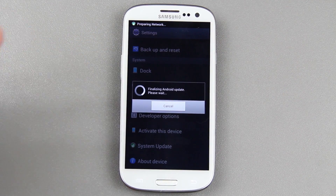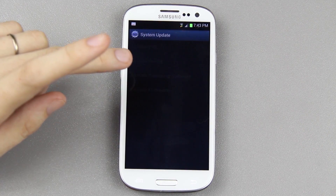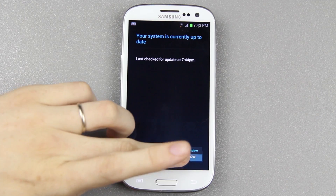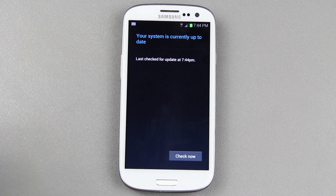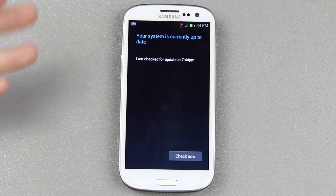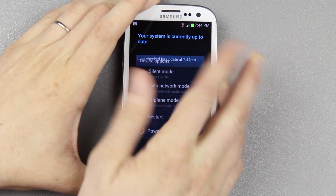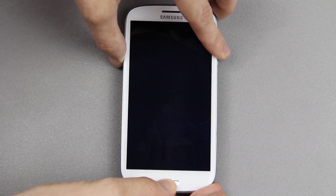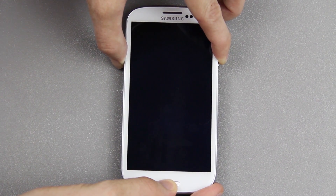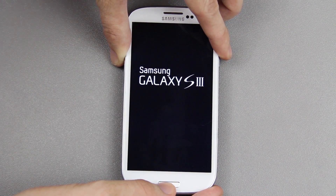If we go to Samsung's update, I wonder if it will actually update. Someone at work mentioned that they got the update on theirs. Update Samsung Software, Check Now. You see that — it does not say that I have an update, and it's been updating over and over again but not showing the Jellybean update. So I'm going to reboot this thing into recovery by powering it down all the way. We need to hold volume up, the home button, and the power button, and keep holding it. It vibrated — booting recovery.